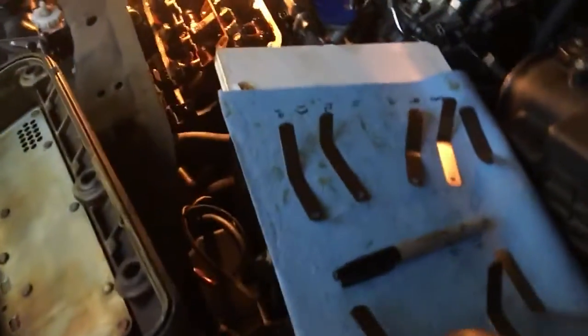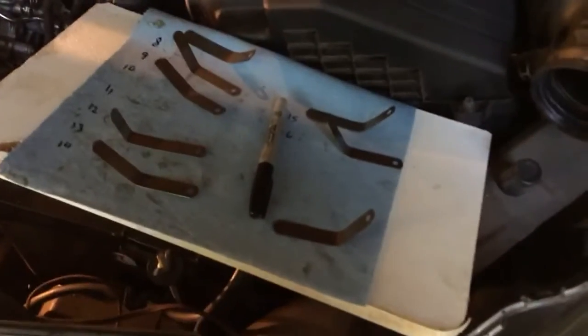Bought a set of these feeler gauges. Don't mind bending them because this is probably the only job I'll need them for. Only $5-10 bucks. And you need a good socket wrench set. You need to turn the crank over, turn the entire engine over, put it in neutral, turn it clockwise. So I have a 19 mil socket under here. Would have been helpful if I had a longer extension or electric tool, but oh well, good old hand.